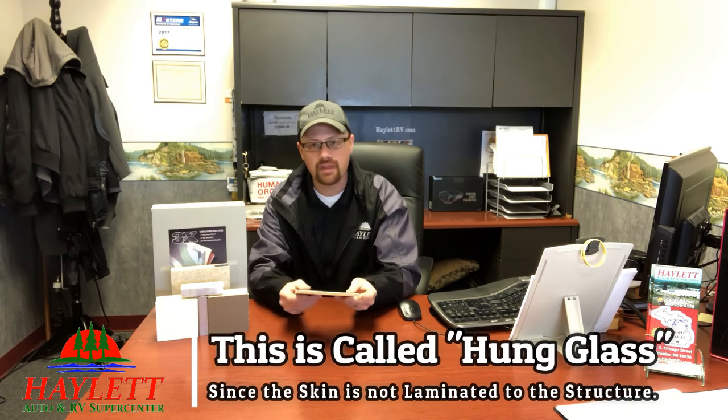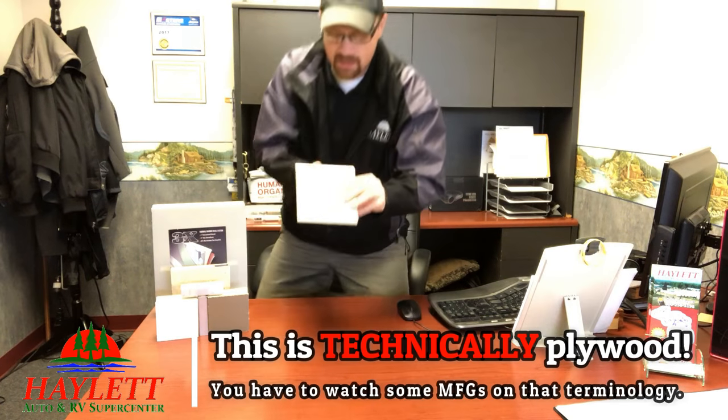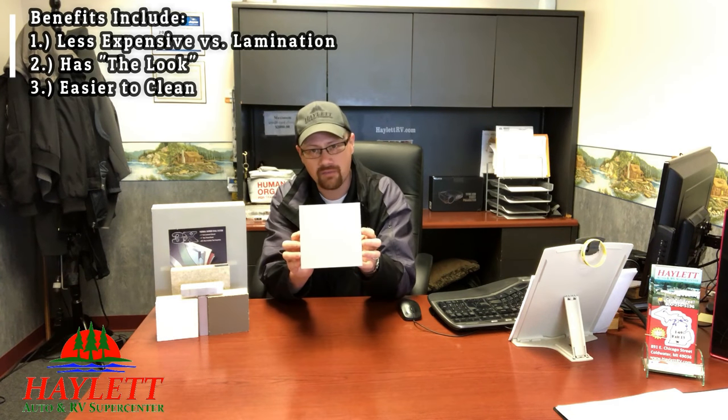What it does is it just puts a pretty skin on the outside. But below that, if you look real close here, there's actually a double sheet of Luan underneath. What that's creating is kind of like a 9mm wooden suit of armor. They take four by eight sheets of Luan and offset them like a brick layer so that you don't really see those vertical lines where the wood meets going down the wall. Interestingly, if you take a wood skeleton trailer and apply a fiberglass option, you're actually increasing weight because you're adding so much more wood all the way around. I've seen it be anywhere from 250 to 650 pounds, depending on the size of the model.